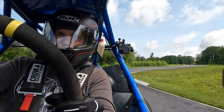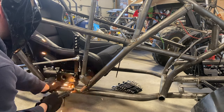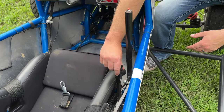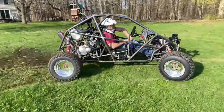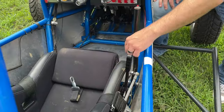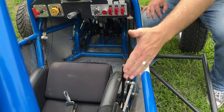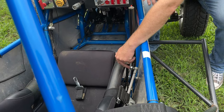It works just as well as pushing the brakes with your feet. I did put an e-brake in here, but I don't use it a whole lot — if I was on a tighter track or wanted to show off it's there for it. It makes the rear brakes a two-part system: I run it from the master cylinder to the pass-through on the emergency brake, then a second line back to the rear brake.